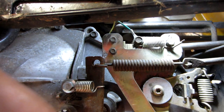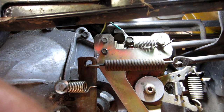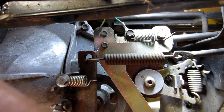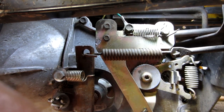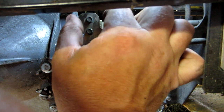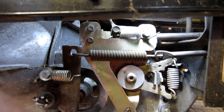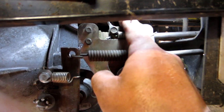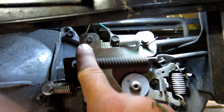What we're looking at here is on the right side. I've got the right rear tire removed and this is the mechanism that runs the pedals that drives the hydrostat. I'm pushing the reverse here and you can see how that's moving. Whenever you push this pedal this mechanism moves forward and these two screws hold a little switch — it's really not a switch. What it is is an insulated wire that is waiting to be grounded. Once that wire touches this metal right here, this is a ground that grounds this bracket.